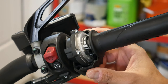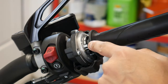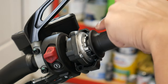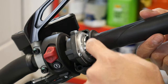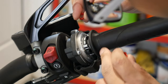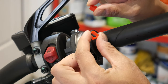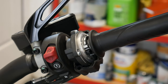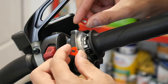The back side of the housing comes away easily once the screws are removed, revealing two little bits inside the throttle that stick out. You can see how the mechanism works with the play in it - that's what these spacers are for. They go onto those little things that stick out and fill in the gap so you don't get that slack while it's rotating. Both spacers are different sizes, so it's straightforward which one goes where.